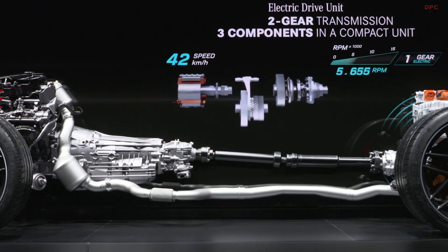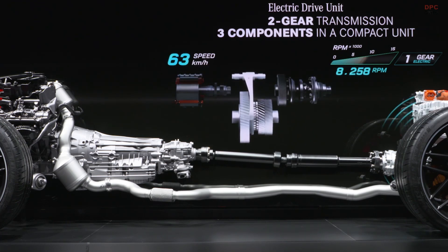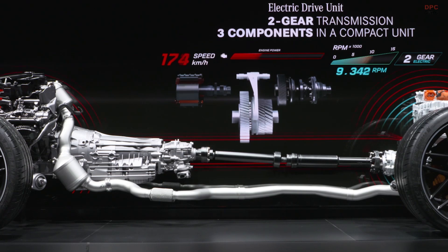The high-performance battery is also located at the rear. The result is a balanced weight distribution — a fundamental prerequisite for optimum driving dynamics. This layout offers other advantages too, for example the highly efficient use of electrical torque. The electric motor acts directly on the rear axle, so power immediately converts into acceleration with an impressive extra boost when starting off, accelerating, or while overtaking.